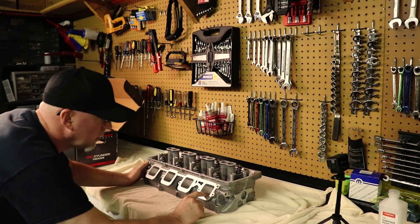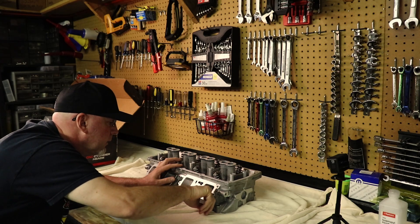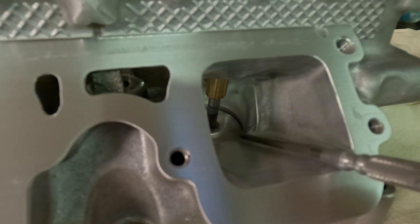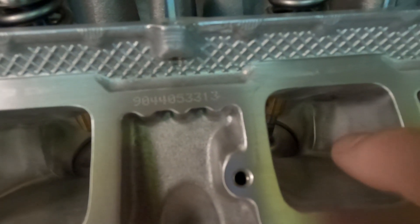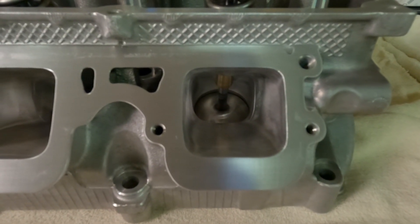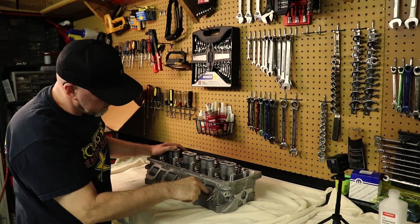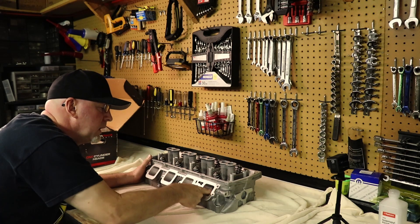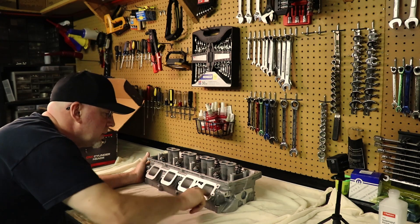The intake ports - wait a minute, there's a ridge right there. There's a little ridge in every intake port on the right side. Pretty smooth on this side, but right there on the right side looks like a spot where the machine didn't touch it, which I understand happens sometimes, but that could have easily been hand-blended out. It would not have taken them long at all. Looks like the machine goes in this way, stops, comes in from the other side - the valve side - stops, and it just didn't get that spot. Missed a spot, and it's a little ridge. I don't like that at all. It would have been too easy just to hand-blend that out.